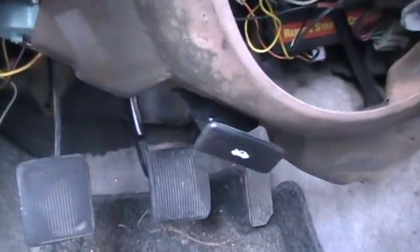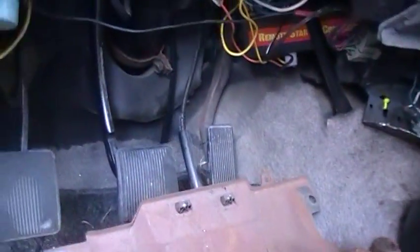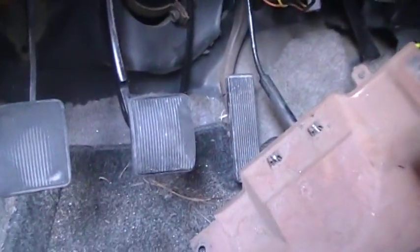So I had to find out how to collect the codes. On this model, 1994, it's fairly simple. If you look under the dash — this is the driver's side dash — I took the plate down that has the hood latch, just because I'm going to be going into the ABS module up here.